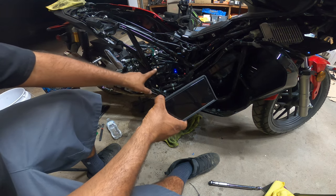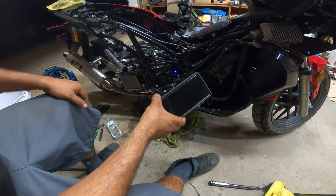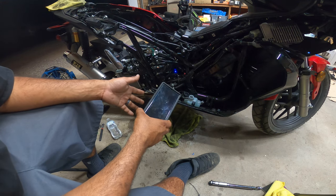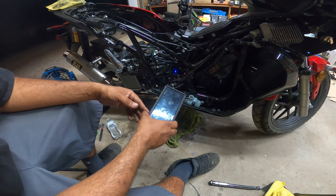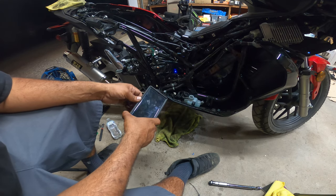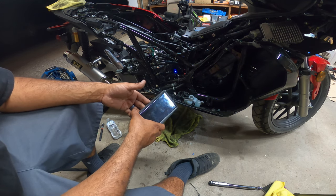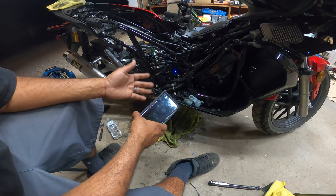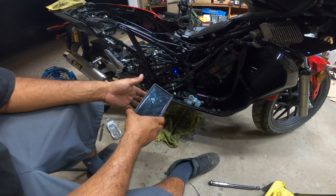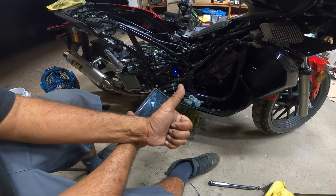Ride it around the block, look for any coolant leaks, for any oil leaks from the head and the water pump side. You just want to make sure before you actually go riding that you don't damage anything, or that you ride and out of nowhere all this coolant explodes out of there. Double check your work. Always quadruple check your work before you go for a ride or something long. Ride it around the block, rev it up, do whatever you want, but don't take a long ride prior to doing this job. You want to confirm that you did the job right.